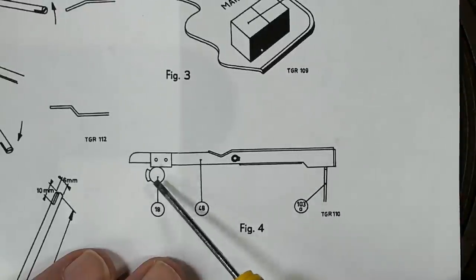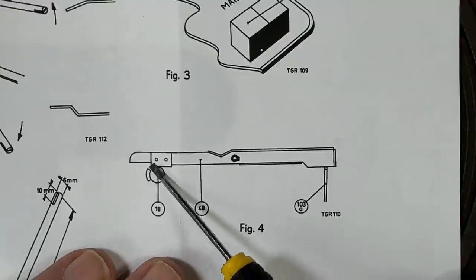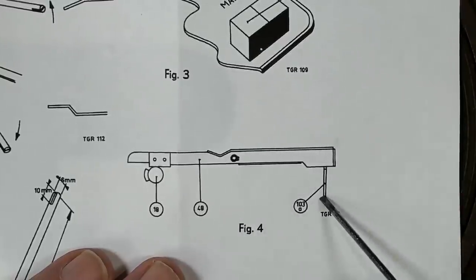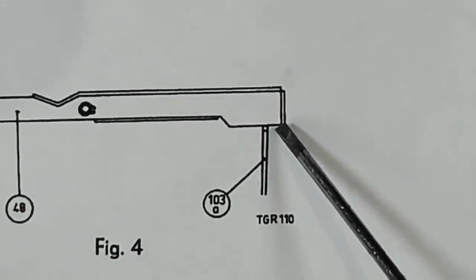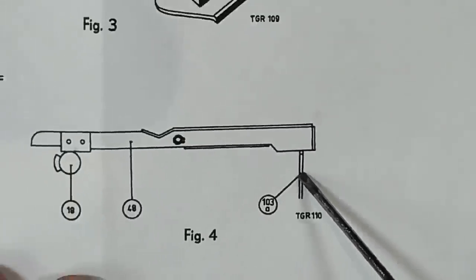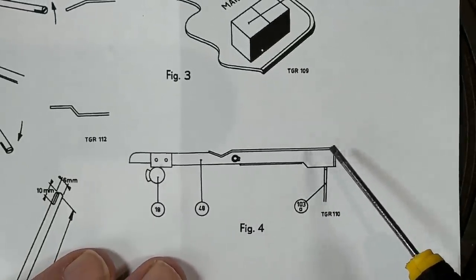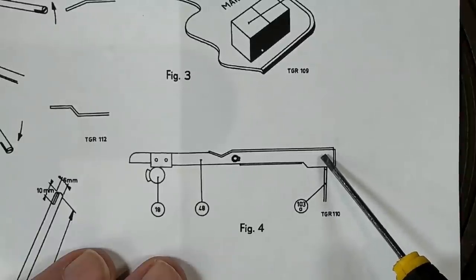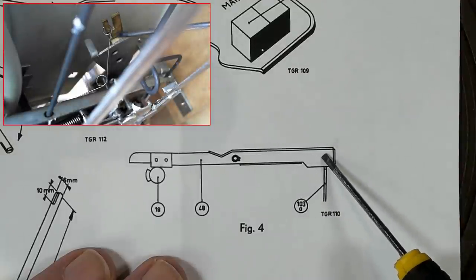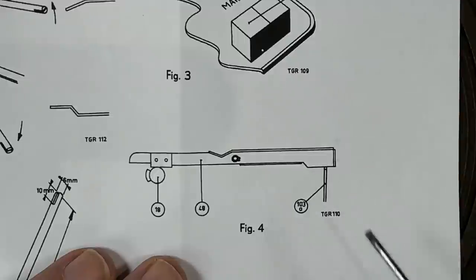I found this drawing — that's the kicker arm. There's the kicker on the turntable part — it comes around, hits the little plastic block here, pushes this arm back, and that trips the gear, re-engaging it with the turntable. Here's the little rod that I've got floating, and that's exactly how they've drawn it. The end of the rod has a little circle on it and it's just pushing against that beam — the way I've got it is exactly correct. So whoever put it in the hole has been in here and played around with this. I approached it as just a gram that had slowly stopped working, but someone had been in here. That shouldn't have been in that hole, and that other spring should not have been in that little metal finger. I'm pretty happy now — I was getting a bit depressed before, and it took me a while to work all this out.